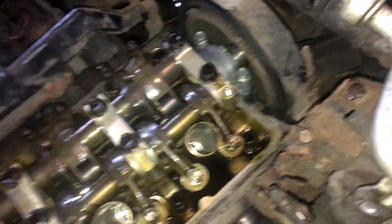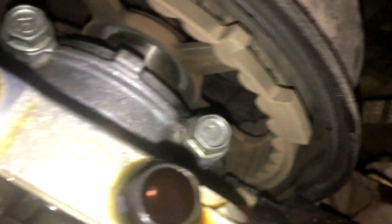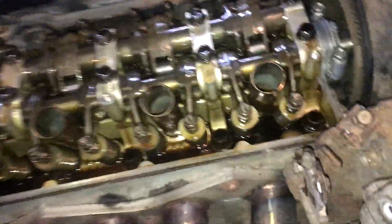For the last cylinder, which would be number two, find the tick down there and look on this side — there's a tick lined up there. You're gonna line that tick up with the top of that little knob again. That's it — now we're gonna adjust the valves on cylinder number two.